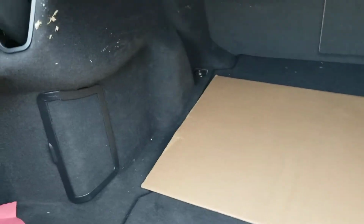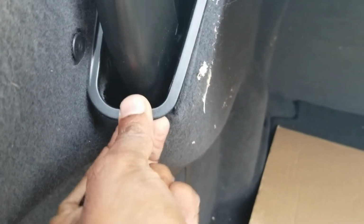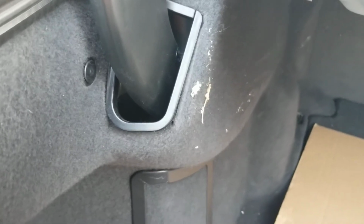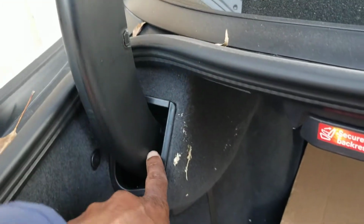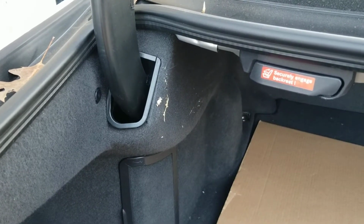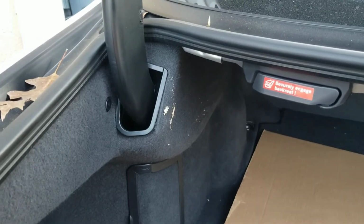and what you'll find is we have frayed wires in here. It's hard to see the wire from this spot in here, but really what's going on is once I remove this, what you're gonna see is the wire is attached to this. So as you open and close the trunk, what happens? The wire moves with it, and eventually with time that wire gets frayed.